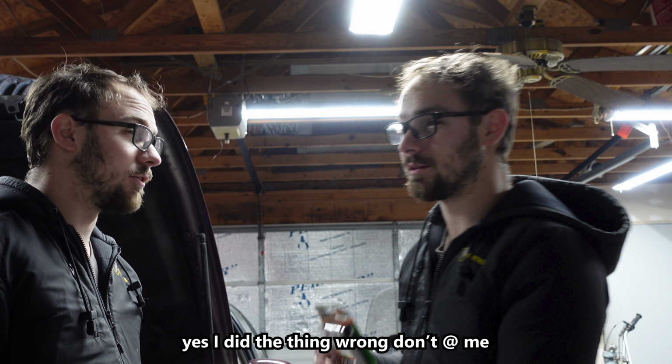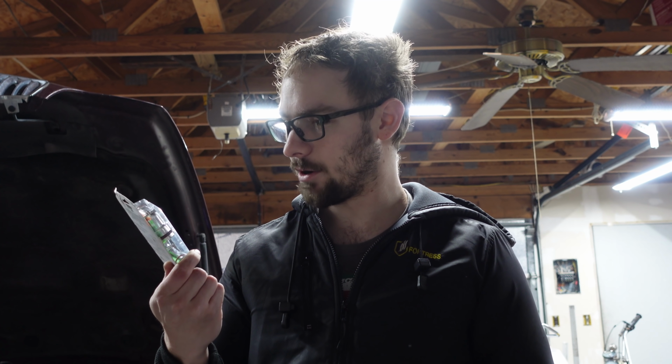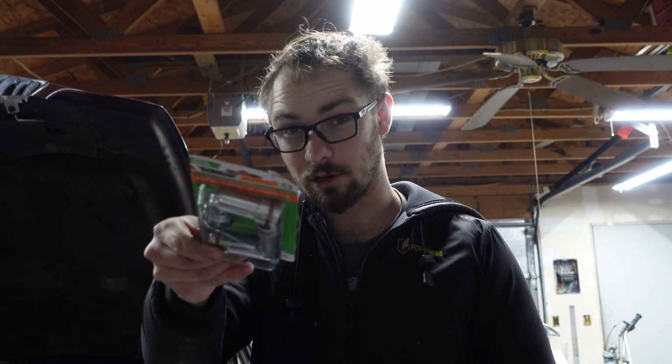But Jake, look, there's clearly O-rings on these elbows already. Yes, I know. I'll explain that. These Dorman elbows, part number 47065HP, do have O-rings on them already. Unfortunately, a massive amount of users and a whole bunch of you commenters have pointed out that there's something a bit wrong with them. These things just turn to goo after less than a year installed and cause all kinds of problems for you down the line.